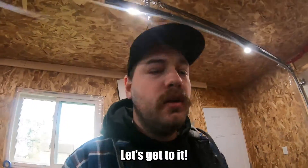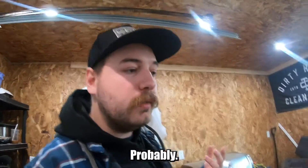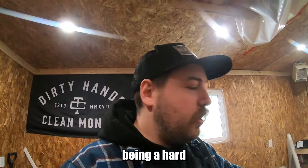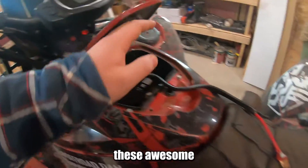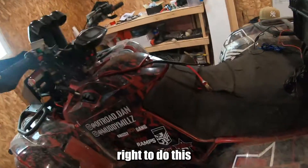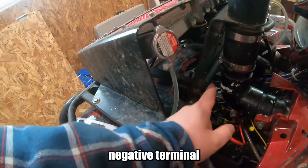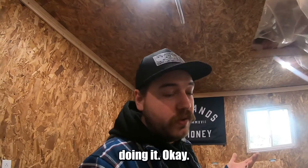Before we get started on this how-to video, I need to give you guys a heads up — my quad is a little bit different than yours probably. To get at my battery I need to get under my snorkels and my rad relocation kit, so it ends up being a lot of work to do anything on the battery. When I installed my snorkels, we ran these awesome extenders, so there is power on these right now. I'm gonna put the rock lights right to this and have my switch in this box. For you guys, you'll be attaching your red wire to your positive terminal and your black wire to your negative terminal on your battery — same thing, just looks a little different.